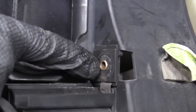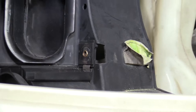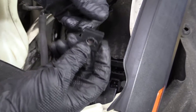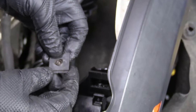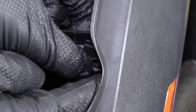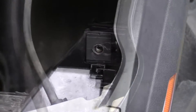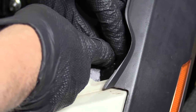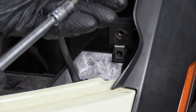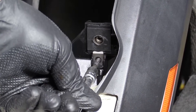This is what one looks like in the vehicle — there's a little threaded insert in there, and that was just spinning in this. So now we just have a nut that's in there that we melted in. We'll reinstall this. You can probably buy these, but for time restraints we had to just modify ours. So we'll just slide this back here, slide this into position. Once that's in position, I'll take this little bracket, stick that back on there — that just holds it in place. I'll use this T20 Torx screw and now we'll just snug it down.